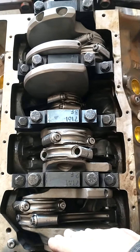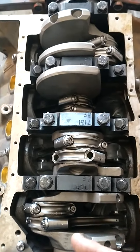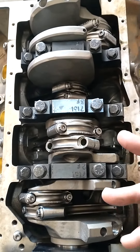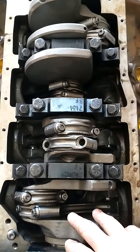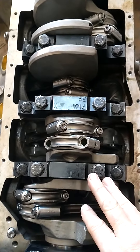General Motors and Mopar and everybody else is very basic and easy to explain — they were looking at the crank when they numbered their cylinders. They went from the front of the engine to the back of the engine. That way, when you are standing there looking at the engine, you've got one bank on the right which is 1, 3, 5, 7, and the bank on the left is 2, 4, 6, 8. But again, totally different engine — Ford engine, numbered differently.